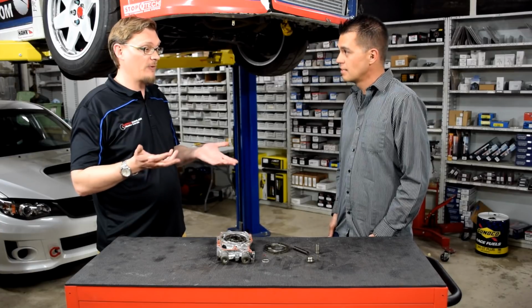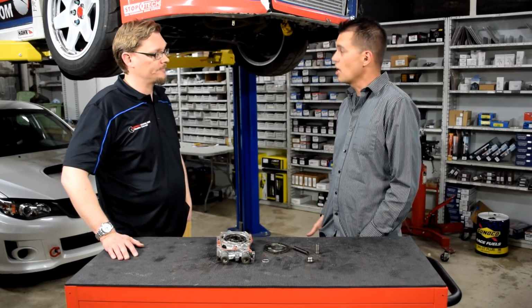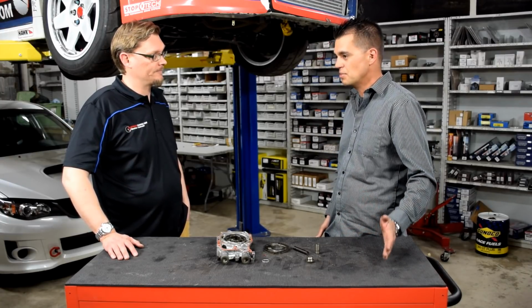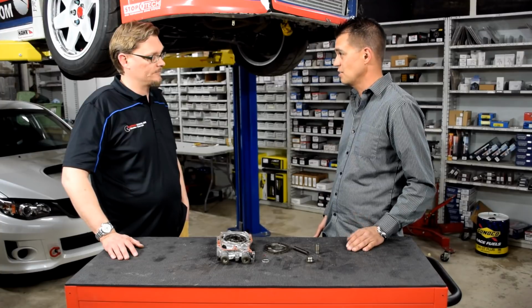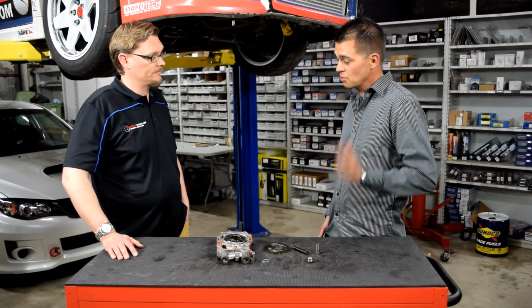So a fair amount higher than what you were seeing even with the shim 10. Once the engine got to operating temperature, it would level out at about 80 psi. And again, remember, I was seeing between 70 and 75 psi in the old setup. So it's changed. Yeah. On cruise, it also stayed around there.